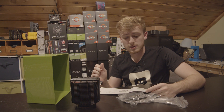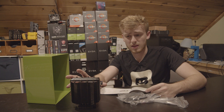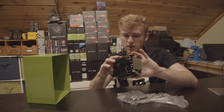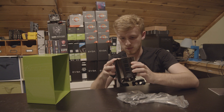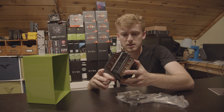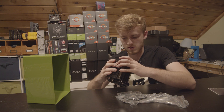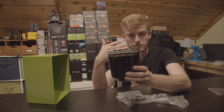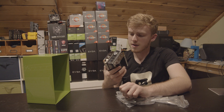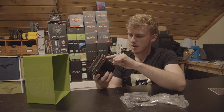For an AMD processor, this supports up to a 220 watt TDP, which I think is insane. It's got two towers, a fan in the center which provides airflow, plus you have the same power connector you'd have on a graphics card, another fan junction so you can hook up a fan to it, and then a micro USB as well.